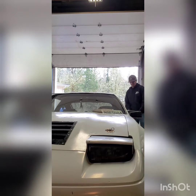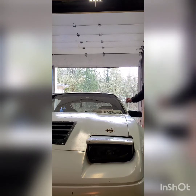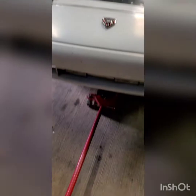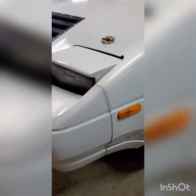Today we're going to be changing out the gear oil on this old girl. After pulling the car in, you're going to want to jack it up — I always jack mine up right from the direct center underneath the engine on the cross member. Put some stands down there just in case it falls off, so that way you don't die.